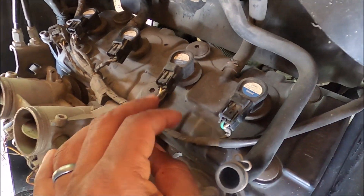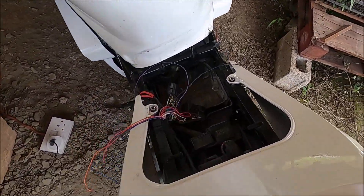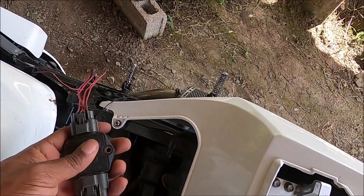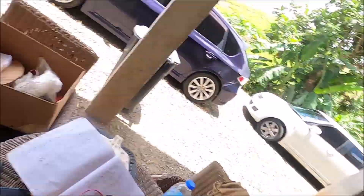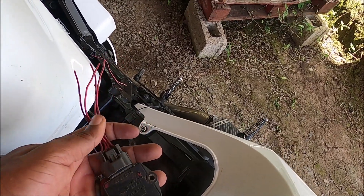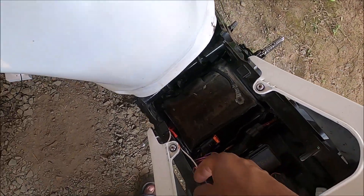The two-wire coils here are 99.9% of the time dumb coils, so you need some sort of igniter — IGBT, whatever you want to call it — in between the ECU and the coils. What I'm going to do is repurpose the four-channel igniter from my E30. It's four channel, so four wires coming out from the ECU will go to it, and that will provide the hardware needed to fire the coils directly from the ECU.